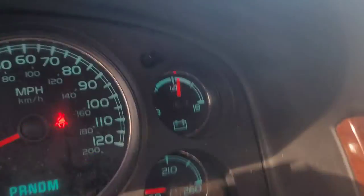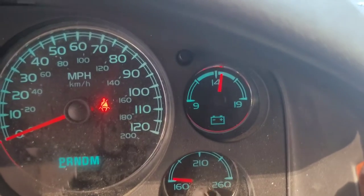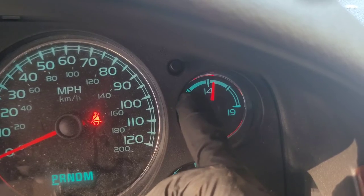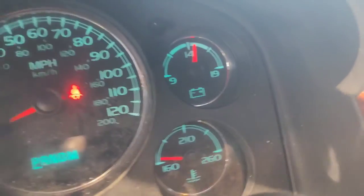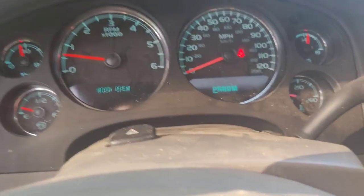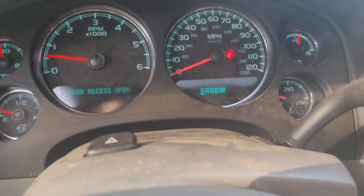Keep in mind that sometimes your battery voltage — usually this one right here — will go down and look like it's not charging. It'll go about halfway between that quarter mark and the halfway mark, and that's perfectly normal. So don't change your alternator just because it's down a little bit. If you don't know how to diagnose your alternator, I'll probably make a video about that one of these days. Anyway, hope you liked it — thanks.